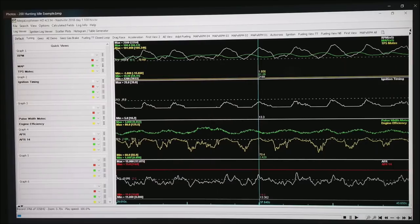Let's look at a trace of a typical motor, viewed with Megalog Viewer HD. I've got RPM in white at the top, manifold air pressure in green, and TPS in yellow. Notice the TPS is very stable, but the RPM is going up and down on the white trace, and the manifold air pressure is also oscillating in sync. These are the two primary factors we use to drive the fueling tables, and if those things are moving around, we're chasing a moving target.